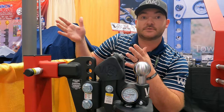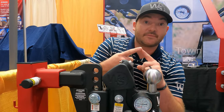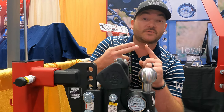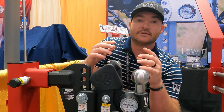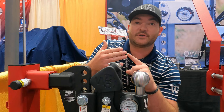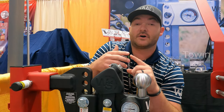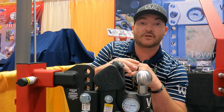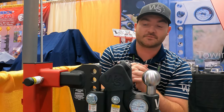The goal is to get your front axle to be at stock height, because stock height is where your alignment is done, and it's going to give you your brake control. Most of your braking is your front axle, so it helps you get your brake control good. It also helps tighten up your steering, because when you're lifted up, your joints and steering maneuverability suffer — it gives you that floating sensation that's not comfortable.